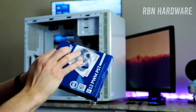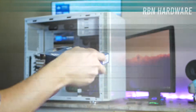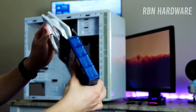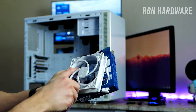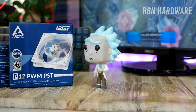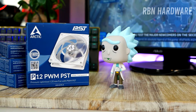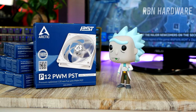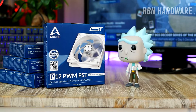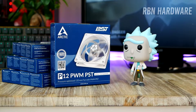I'm gonna be using these four-pin PWM operated fans. Unlike the older three-pin fans I had in the other case which ran at full speed all the time, these can communicate with the motherboard and will only speed up when the system needs it. When the system is not doing any heavy work, the fans will remain silent — not even spinning — since they have a mode called zero dB mode, which lets the fan switch into a silent passive mode when the PWM signal is below five percent.